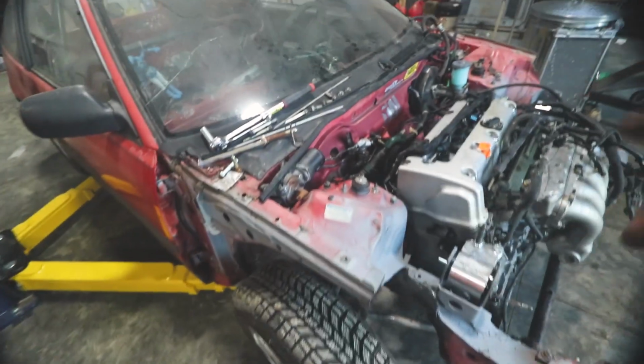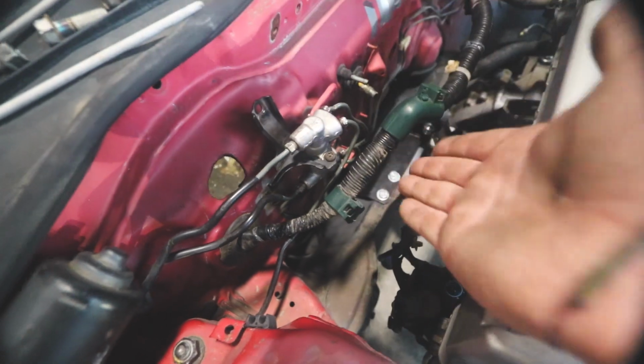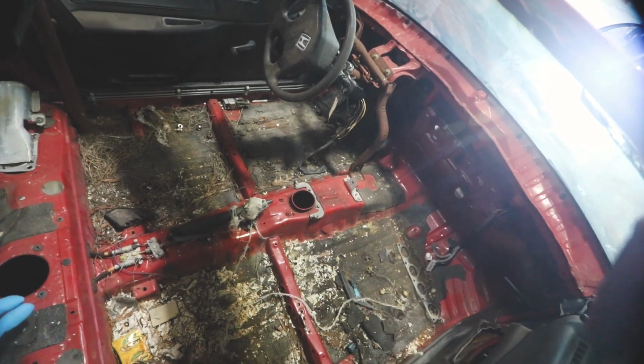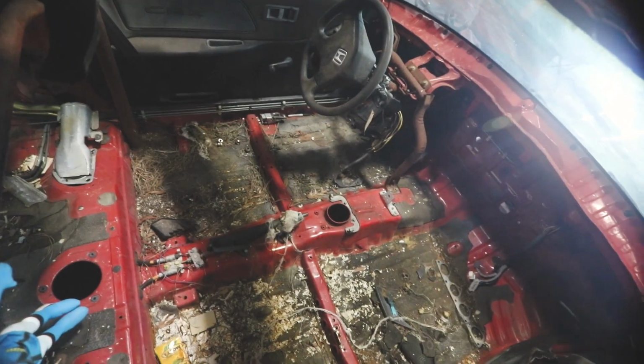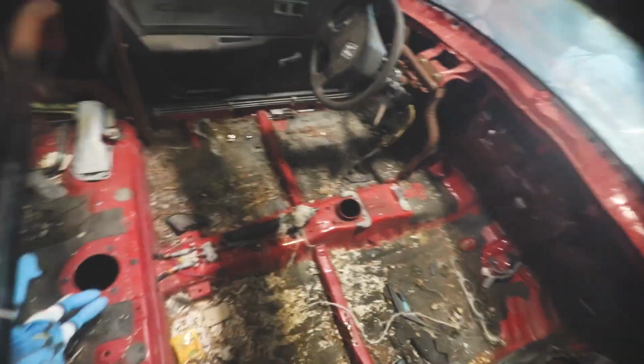The ECU will be in here Monday, kind of like I said earlier. I did go ahead and put a proportioning valve off of an EG in here because it mounts differently. It mounts against the firewall, so that kind of clears up all that real estate there. Dudes, it's in. It's really there. I feel like McLovin. It's finally in. I took the dash back out of it, started kind of straightening up, seeing what I got as far as where I can mount some stuff, because I want to do a plate there for the ECU and the fuses and all that good stuff.